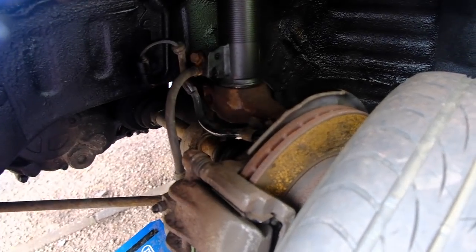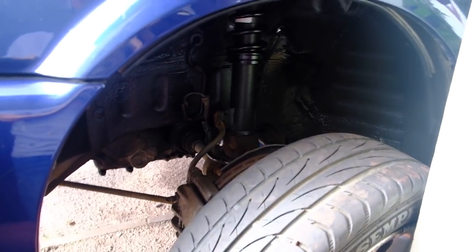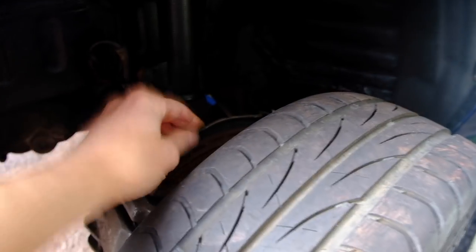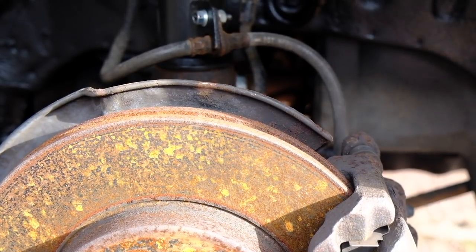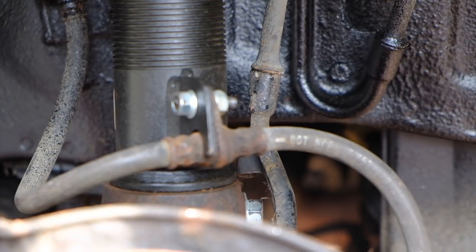Like a glove, maybe? That's side two done, although I do still need to reattach that because it's a bit tight. Once the wheel is on and I can move the car, I'll tackle that track rod end down there because I can't actually get to it with this post in the way. But that's two sides — two wheels to go on. I've just noticed that this heat shield, dust shield, whatever you want to call it, is straight and not bent, whereas the one on the driver's side has clearly taken a whack when I was trying to get the bolts undone. So I'm going to straighten up the one on the other side before the wheel goes on.